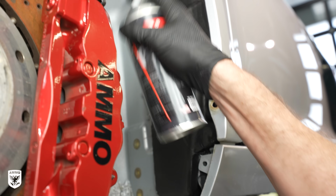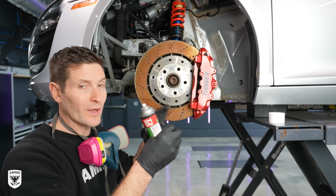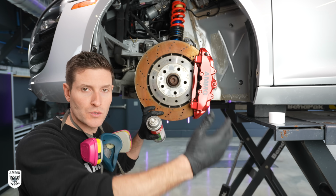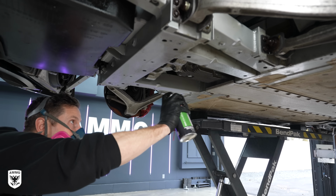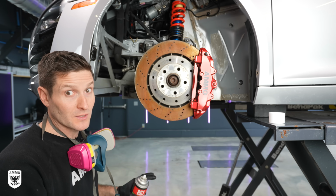It's gonna prevent rodents from going in there because it smells like peppermint and has these other oil additives in there. At the same time, it's going to add a bit of oil to the undercoating to prevent future corrosion. So does it last forever? No, but I do think it's a great seasonal thing, especially when everything is open like this. So we're going to spray everything except the bolts with this right here and keep the mouse out.